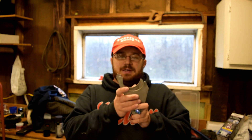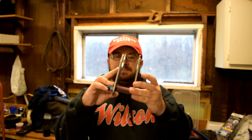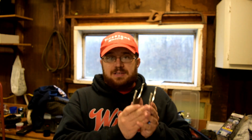Hey guys, we are back out at Kyle's house. I had a little problem solving I had to do with the traction bars. As you may remember from last time — if you haven't seen last video, go back, the link will be in the description. We were working on the traction bars, and this is the rear mount for the traction bars. I showed you guys these singular pieces last time. There is now a bolt between them. This bolt is a half-inch bolt, which fits through the original holes that were in the blades. The other bolt was a five-eighths bolt, which is bigger.